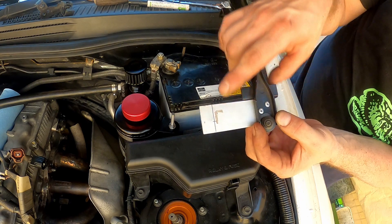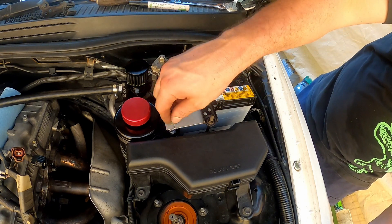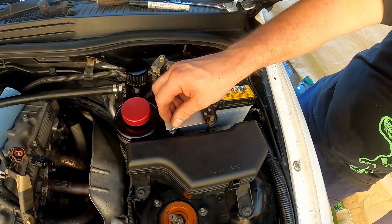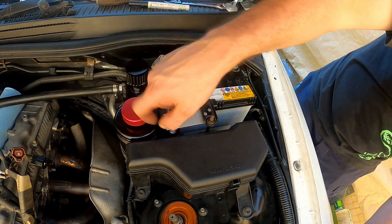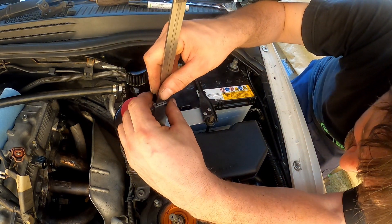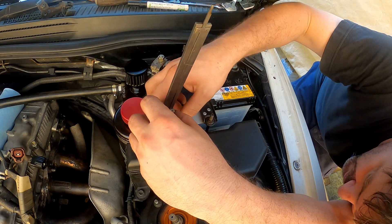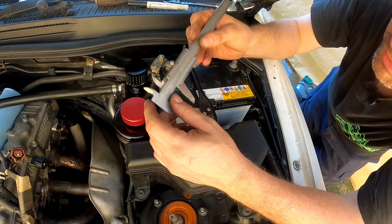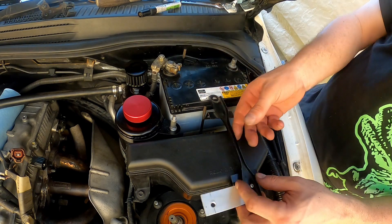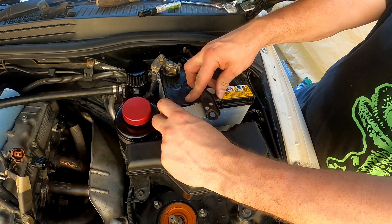Transferred my scratch over to this side, put it in across, and here we are. I've drilled my hole, put my nut on there. There's only one more thing to do, and that's to make another pipe that goes underneath this to support it so it doesn't go up and down. We'll sandwich this in. Just need to measure that distance there with some calipers — 2.2 centimeters, or 22 millimeters long — then this will be perfect. Let's cut out this tube, two pieces of tube. That goes on there like that.